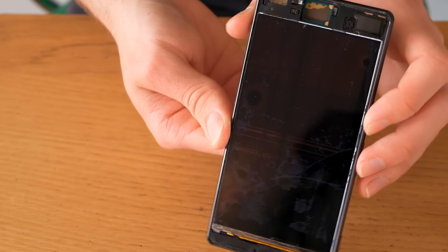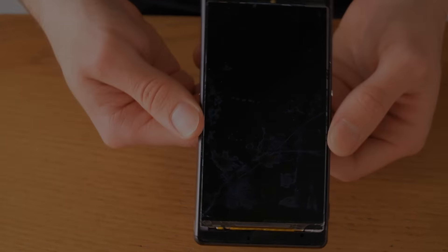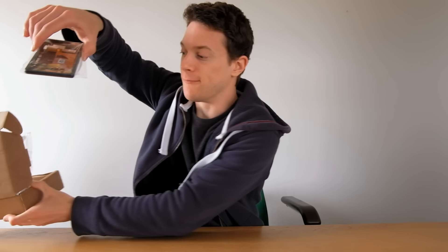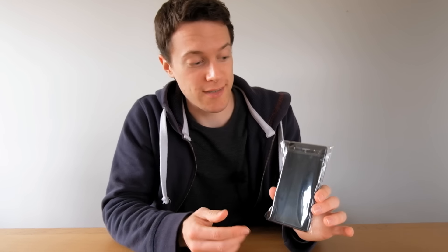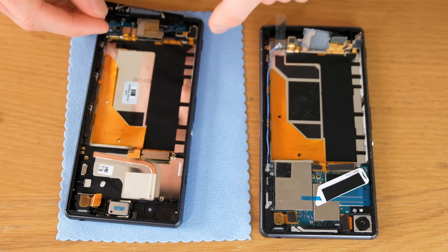It's pretty safe to say that isn't working properly. So that didn't quite work out as hoped, but what I've done instead is ordered a replacement screen with the chassis — £40 from eBay. It's a used part, so it has the original screen, not a cheap replica, and it looks like new. Another benefit is that rather than replacing just the screen, it's the whole chassis, so I'm going to be transferring the motherboard and other components, which is much easier — just putting the old components into the new chassis.